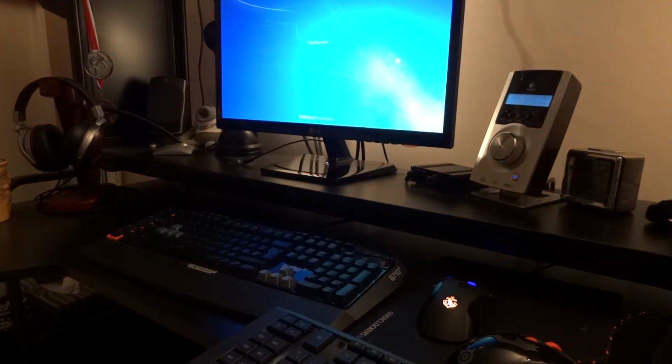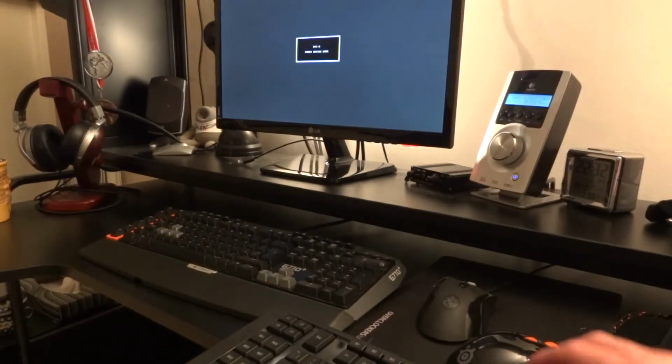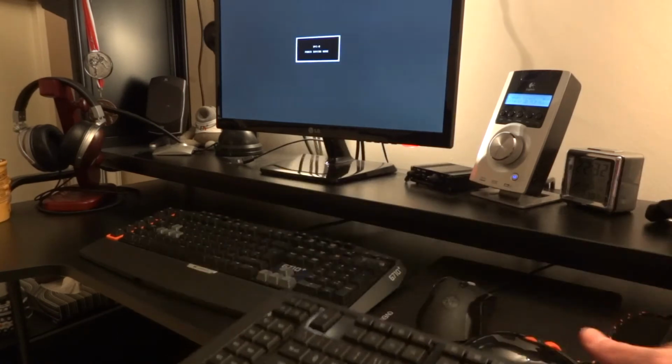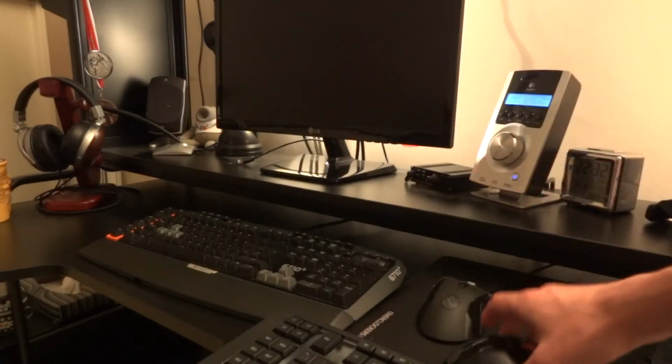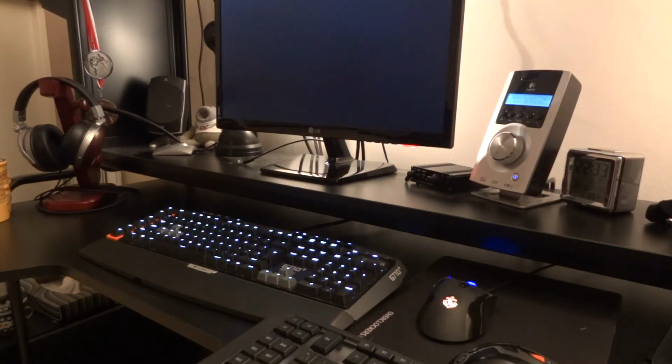And what you'll see now is that my Anker mouse will work perfectly fine and my keyboard will work fine, but as you can see, the SteelSeries things are both disconnected completely. I have also enabled ERP in the BIOS. ERP basically is power to USB. I've enabled that, and unfortunately that hasn't helped me at all.